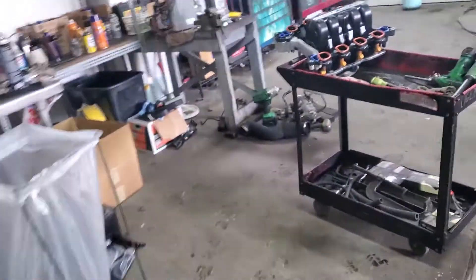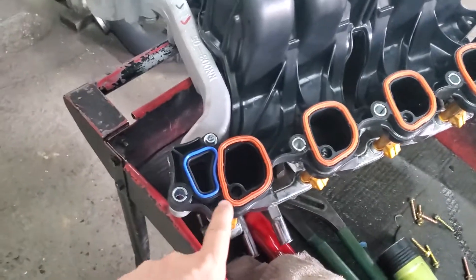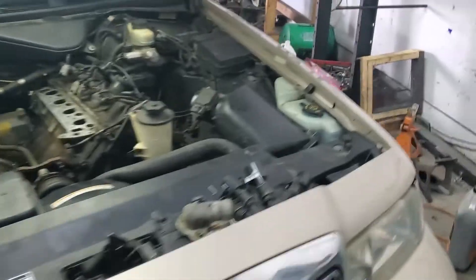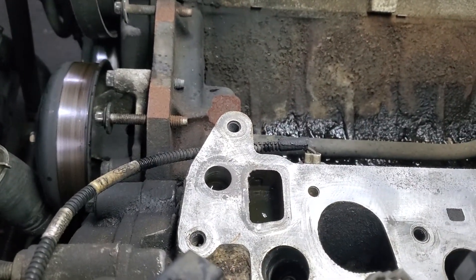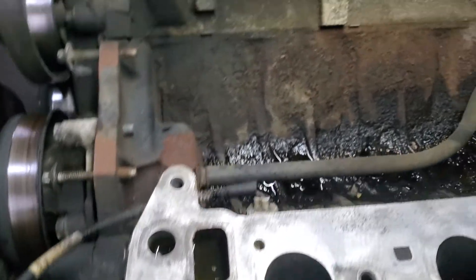The new Dorman intakes come like this with the gaskets already in it, but these gaskets are not sealing that hole. So if you're getting a lean code and you're smoke checking it and getting smoke out of the corners, or you're hitting it with brake cleaner and it's only leaking in the corners — and you keep tightening the bolts down — it's because of these dowel pins.